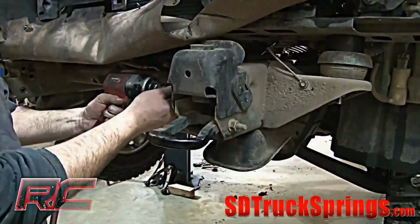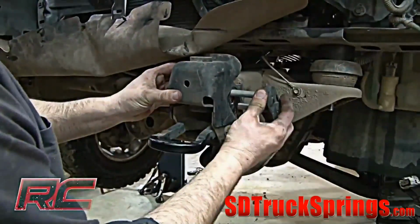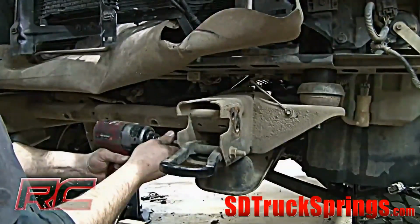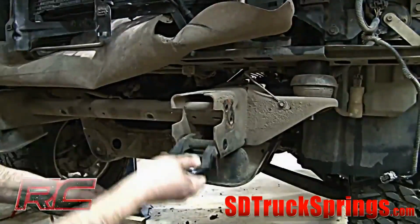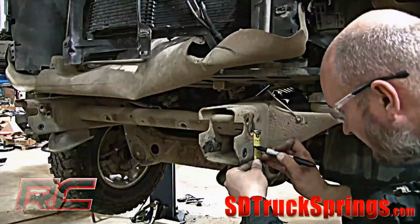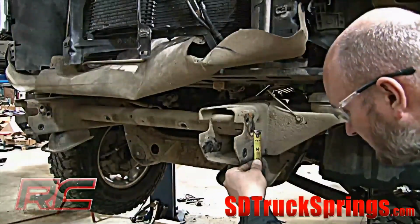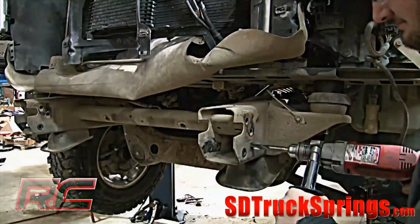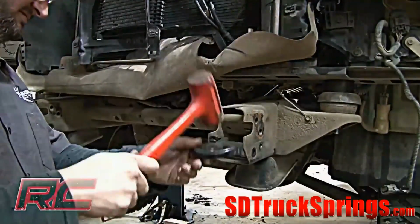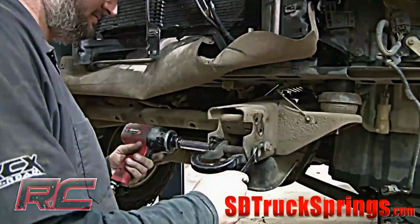Remove the two bolts from the driver and passenger side front bumper brackets. Retain the stock hardware. Mark the front tow hooks as driver and passenger top and remove hardware. Measure 1 7/16 inches down from the second bumper mounting hole and mark. Then drill a hole using a 1/2 drill bit. Install tow hooks so they are upside down and install the stock bolts.